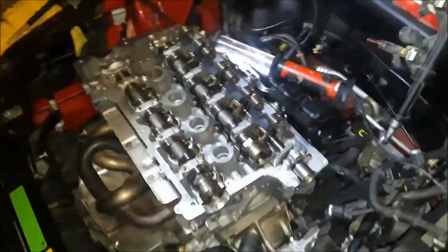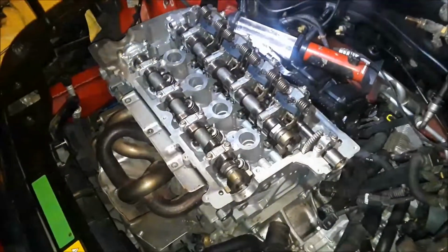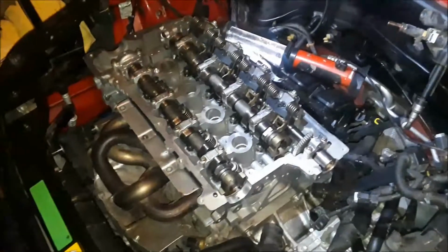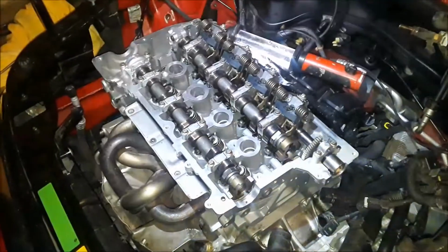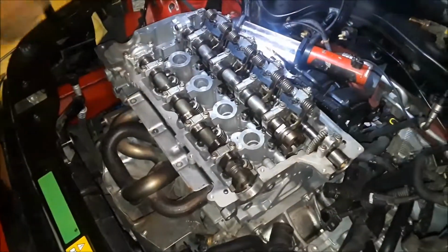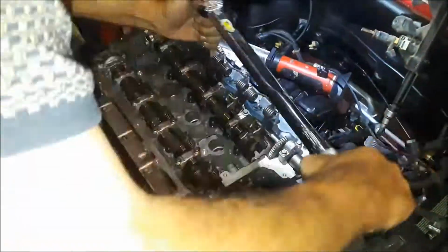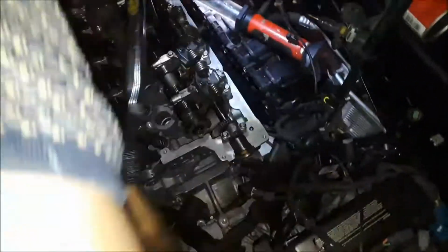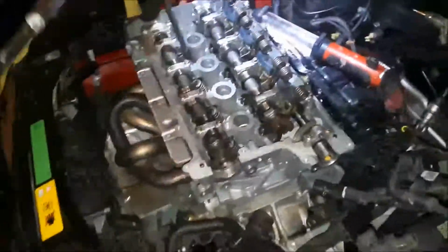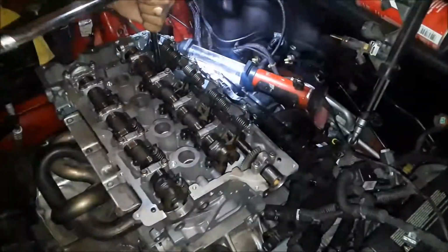90. Okay, that completes the first 90 degree pass. And now we have to go back through and do all the same pattern, 90 more. And then the head will be mostly torqued down, and then we'll do the outside ones, which are pretty easy as well. Okay, here we go. Once again. 90. 90. 90. 90. Oops,